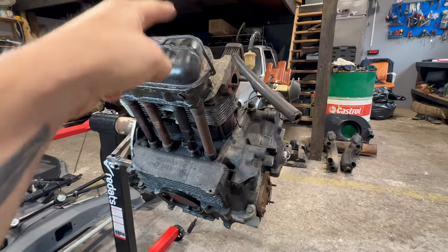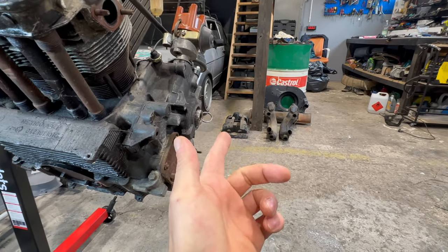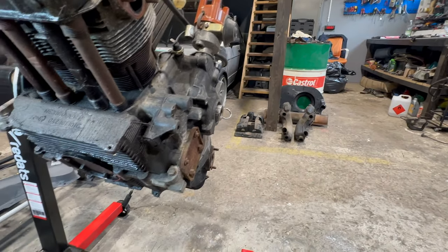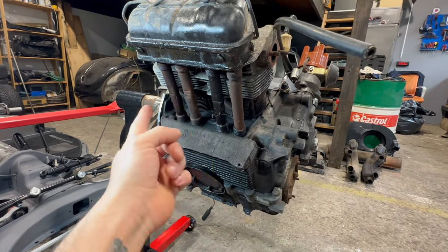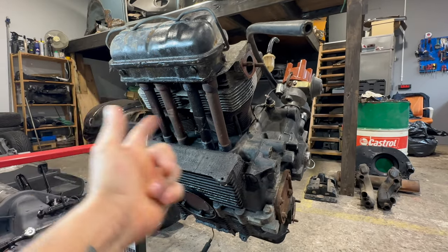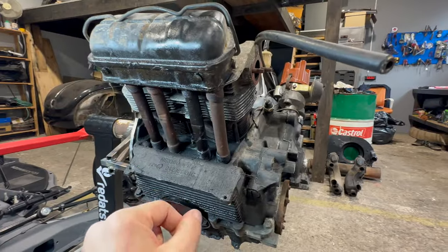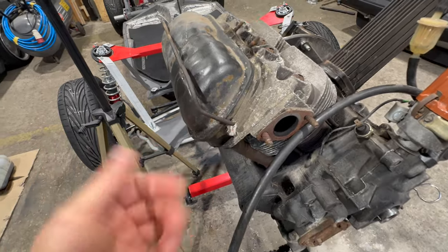The only thing I did to that engine was take off the accessories, and the tins and parts visible in the engine compartment were sandblasted and powder coated — the rest was left like that. So I guess back then I didn't pay enough attention. We will have to take off the heads from both sides and replace all four pushrod tubes on each side — and they are probably leaking oil as well.